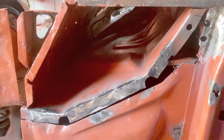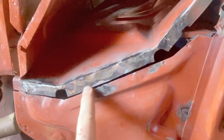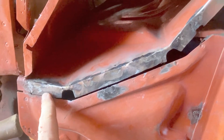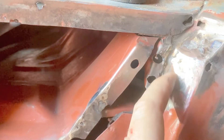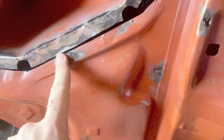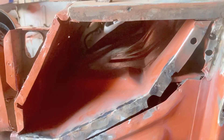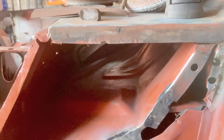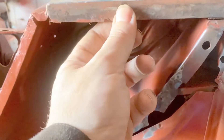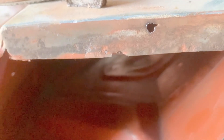Running out of battery and it's almost lunchtime, so probably a good place to leave it. I've replaced this piece and this piece, done a vertical hole going down there and a couple of small ones up here, and I found a couple of new ones too - plugged those up. Problem is around these areas I keep blowing through, and this metal feels very thin, especially around some of these holes - it's just worn through rather than big rusty patches.